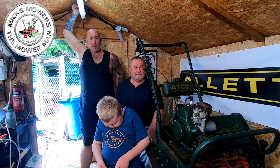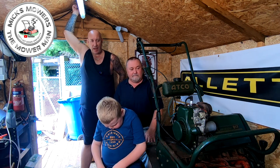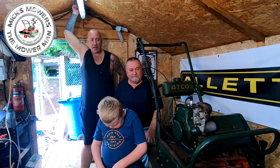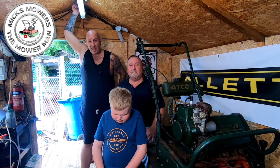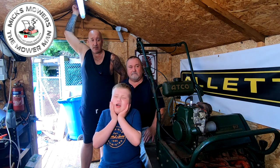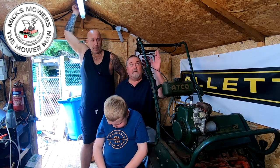Okay. Mikuni carb on top. You've had a carburetor off. I know you had problems with the main jet. You couldn't get that out, but you've managed to retrieve the main jet and what have you. So the carburetor's been overhauled, and you've had to adjust the tick over to make it so it doesn't hunt as bad. Yeah. New throttle cable's gone on, all that sort of stuff.